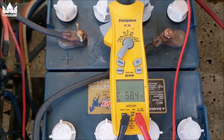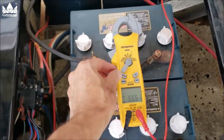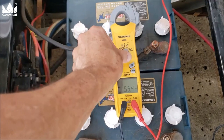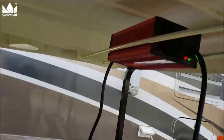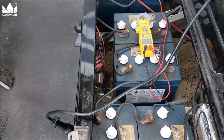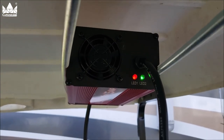Reading 58.3, 58.4 volts. The charger just kicked off — it got up to about 58-point-something volts and disconnected. The meter is beeping because it's detecting over 30 volts. It's doing a great job. I just need to figure out a way to tuck the wires when not in use. Just so you know — when it's fully charged, LED one will be red and LED two will be green, letting you know it's fully charged and ready to go to the golf course.